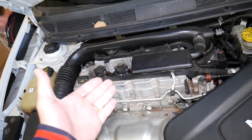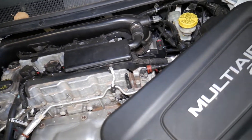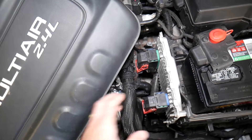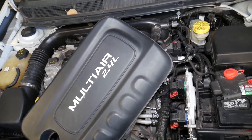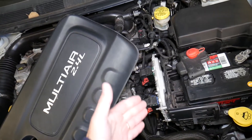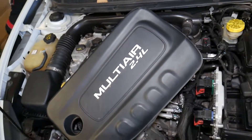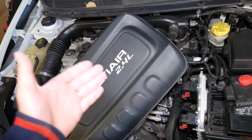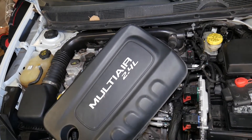It could also be a weak fuel pump, a bad fuel pump module, or a problem with the engine computer right here. Sometimes that can happen as well — in the past we replaced almost everything we could think of, and it turned out it was just the computer: some diode inside was burnt. We sent it for repair and it was fixed immediately. Hopefully this video will be helpful for anyone trying to figure out that code. Thank you for watching, please subscribe for more videos.